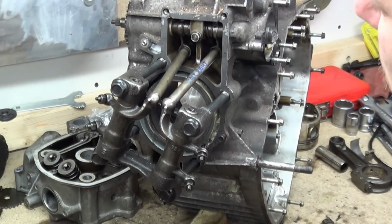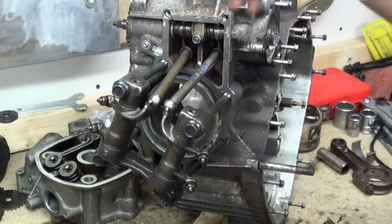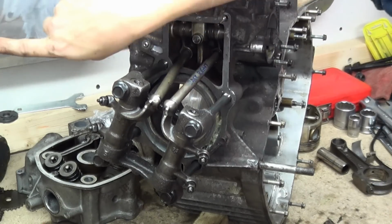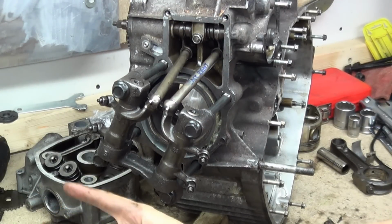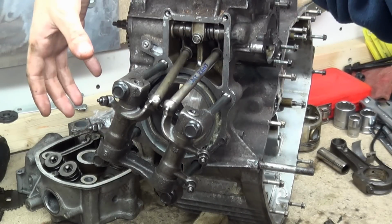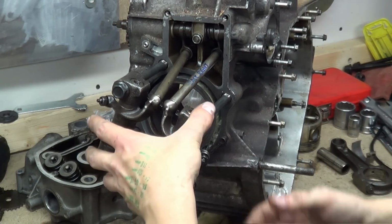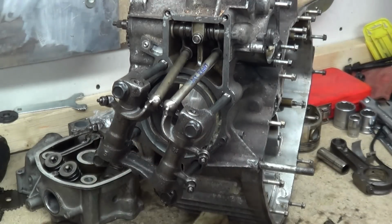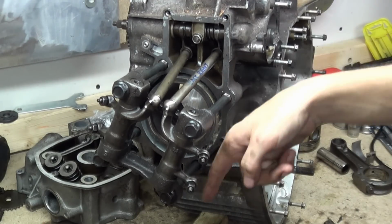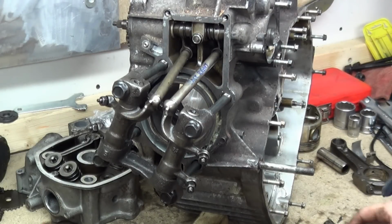And what I'll do is I'll move you. So this is the reason why Honda had to opt for push rods. Because they wanted each carb inside, because this is where you sit as a rider. You sit this side. Can you see me pointing? Yeah, this side. And this is the front of the bike. They wanted the carbs on the inside, and the exhaust they didn't really care about. But as you can see, very clearly here, without the cylinder in the way, you can see the twist. So you can see how this bolt pattern isn't square with the block, and the whole thing's been twisted. So that's why they used the pushrod system.